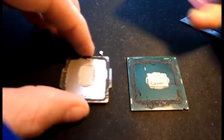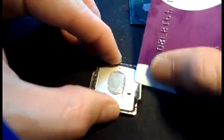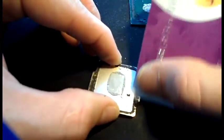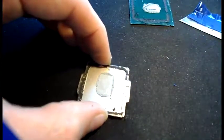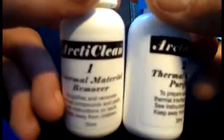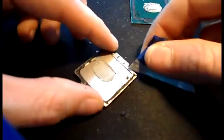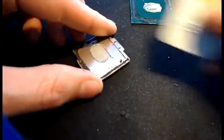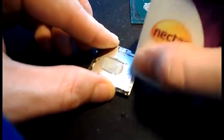The point of the credit card is to remove the silicone from the top of the processor - keep it flat, scrape it, and it just comes right off. If you've got some Arcticlean, this stuff is amazing - it will take most of it off once you've got the bulk off and leave a nice clean surface. Anyway, wrong one - picking up the razor blade, want to move that away. Coming back, just scrape along the edges, take all that silicone off, leave yourself a nice flat surface.